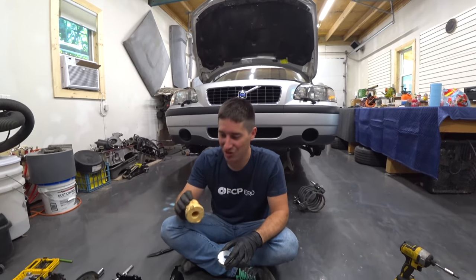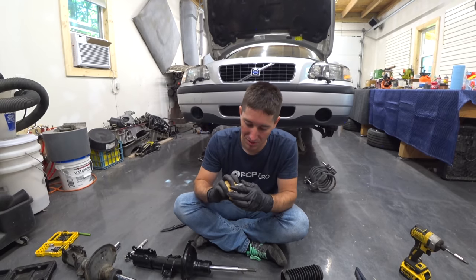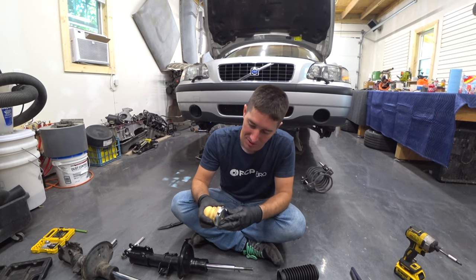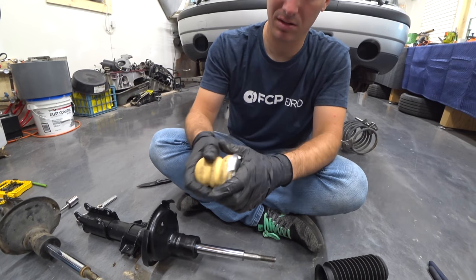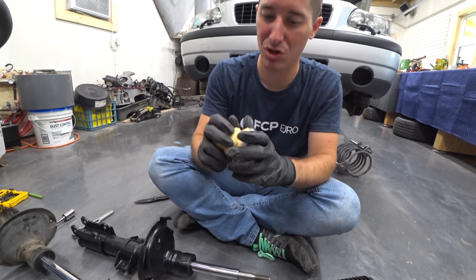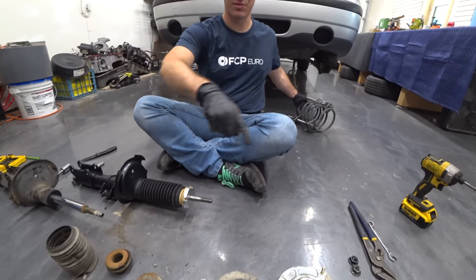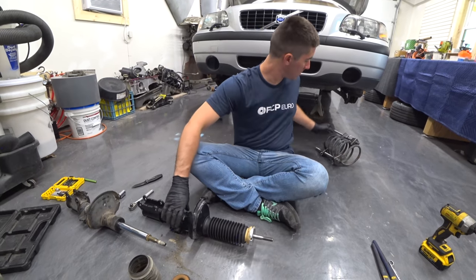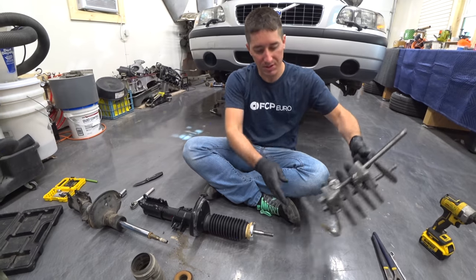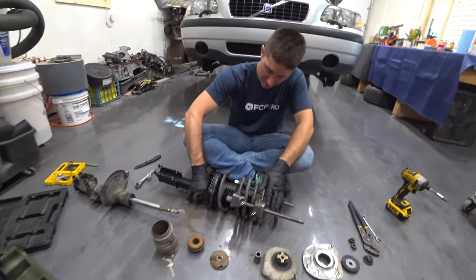The much, much nicer Volvo bump stop and assembly here. So we're gonna slide that guy into its little tab until it starts to lock in. Do the same over here. This all just sits in there so much nicer than that. It must have been aftermarket already. Rubber seat. Has little retainers, give them a little tug, and it goes right in. Yeah. And then slide the death machine on there.